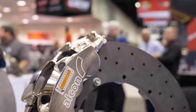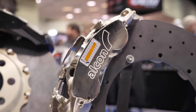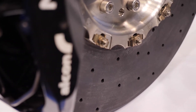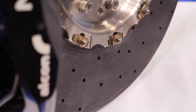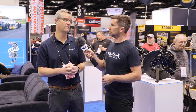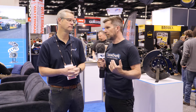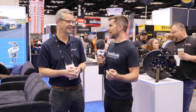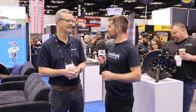A carbon ceramic rotor was developed from carbon-carbon. It basically has added elements that improve the wear of the disc, which makes it much more suitable for the street. It performs very well when it's cold and through the temperature range. But carbon ceramics still have issues where when they run very hot, the wear rate accelerates very quickly. That's obviously not a major consideration for a race car, but definitely much more of a consideration for your road car — you'd like to know that the first time you hit the brakes coming out of your garage, the car is going to stop.